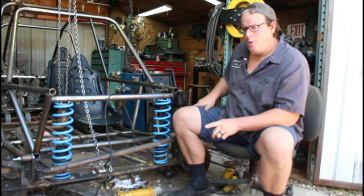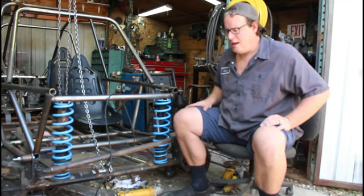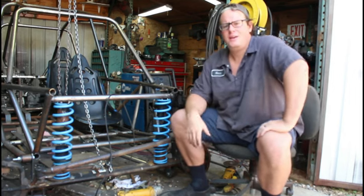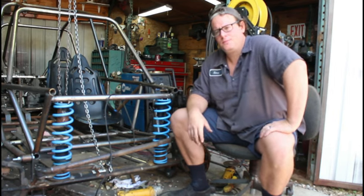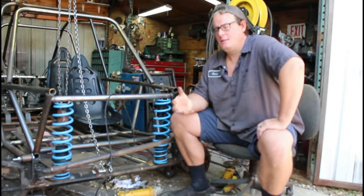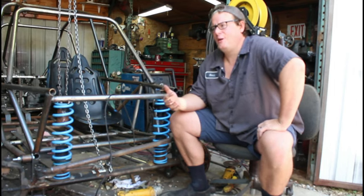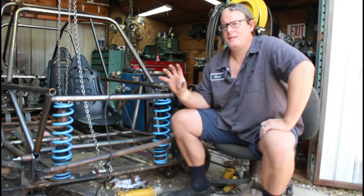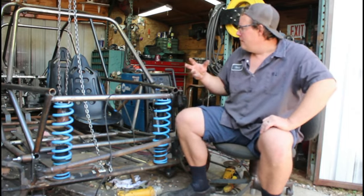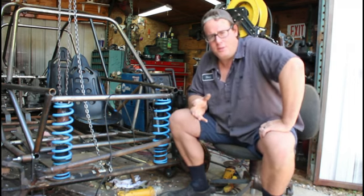Now, putting the motor so close to that side of the trailing arm presented another problem. I couldn't run a conventional trailing arm that had your pivot on the outside and then an inner pivot. Because the motor's too close, the path from the inner pivot to the outside was right in line with where the motor was. Well, how did I solve that problem? Instead of running a conventional trailing arm suspension, similar to a Volkswagen, but independent with shocks, I ran what was, I guess, technically a 3-link, where I have a solid trailing arm on the side, and then I run 2 parallel links off the back to take up that load. Now, I don't know the exact term for it, but I'll just call it the Gazer 3-link because it looks awfully similar to what Gazers run on the back of a Polaris RZR.